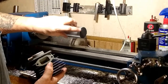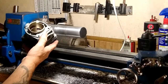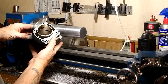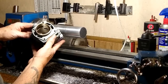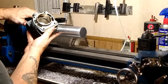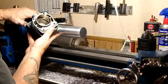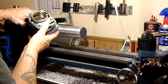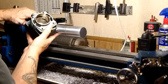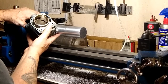You can see where it's loading the sandpaper right there. I'd show you inside but there won't be good enough light to tell. It does appear to be cleaning up the squish band — it's not really widening it; I'd have to go to a coarser sandpaper for that. But I think I'm going to let it go at this for now, clean it up, put it back together, and see if it's even affecting the squish band at all.